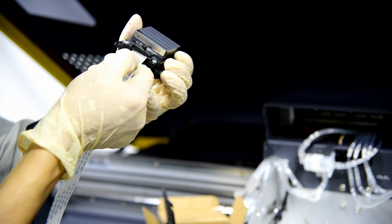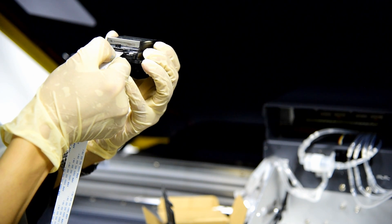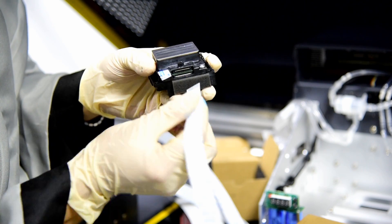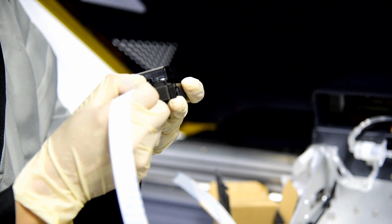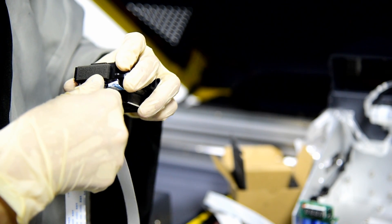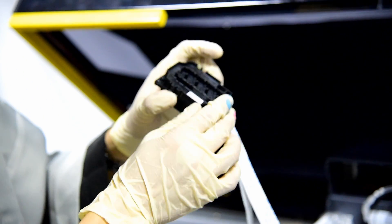Make sure it's flat and new — no bend, no damage, no scratch, and no liquid before you install. Then we connect the cable with the print head. First we install the down cable, pin with pin, with the blue side facing up. Then we insert the up cable also — upside goes with upside. Be sure it is fastened.